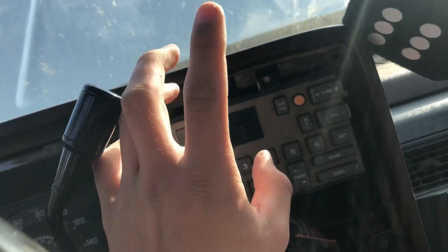And the other one — none of these are hard. Climate control comes out with these four seven-mil bolts that go around it, and you unplug that. I'm pushing the top — one hand's a bit of a challenge. Radio now comes out. It's three sevens but I only have two in. Radio's out now, but I forget how to unhook this — you might have to cut it, I don't know. Now you can get the last two cluster screws — one right there, one right there.